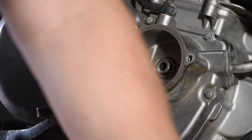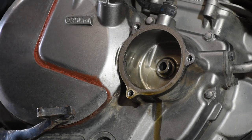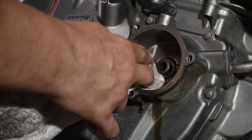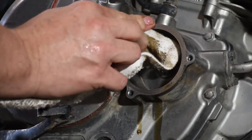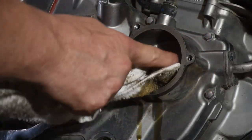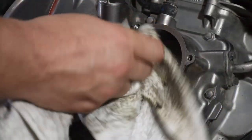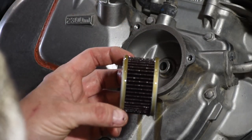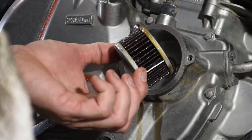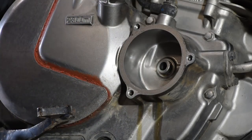My oil pan has a nice little spot I can set that on to drain. Take a clean rag and you're just going to mop out any remaining oil that's inside the oil filter housing itself — it's always a good idea to do that. I'll come back with a little bit of brake cleaner and clean this surface up. I always like to check if there's any kind of shinies on the filter itself — any kind of aluminum that might indicate wear — and this one looks really good.